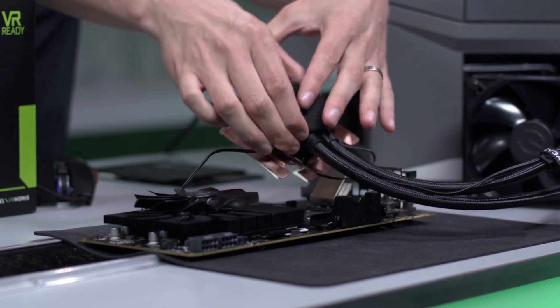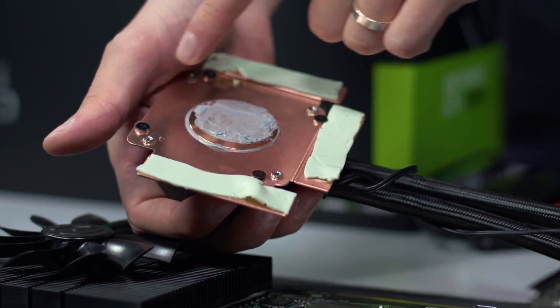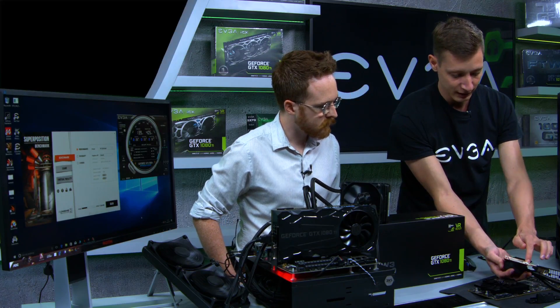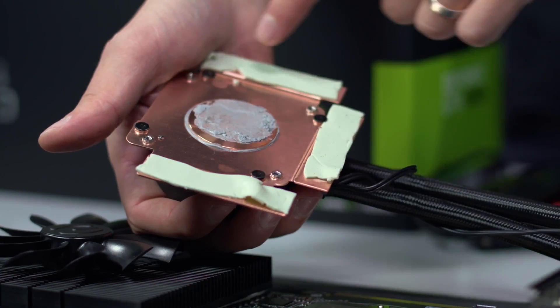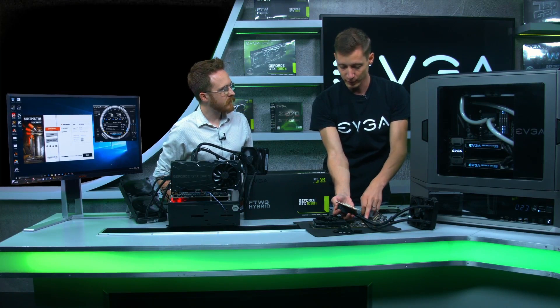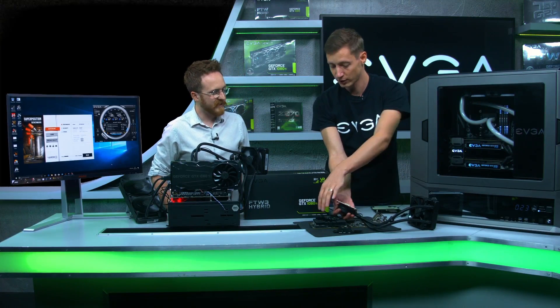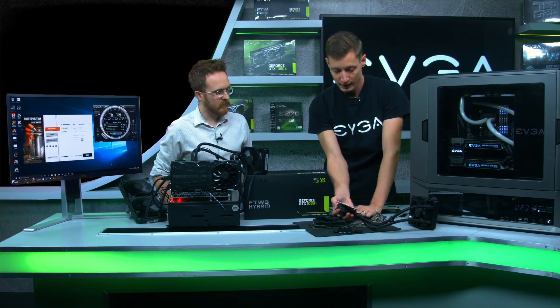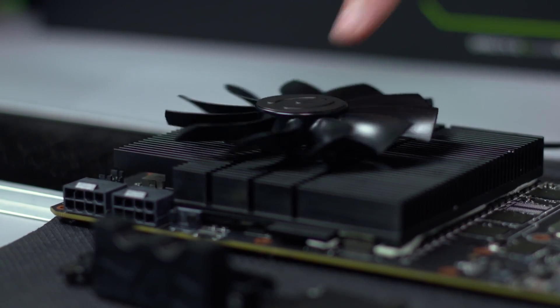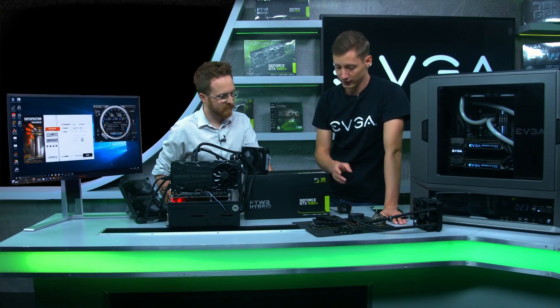What's really unique here is there's also a dedicated copper plate — not just the copper base for GPU cooling, but another dedicated copper plate connected to the copper base to cool the memory ICs. You don't usually see that, but it's very important on this generation — not just for the GPU but also the memory ICs and power. That's why we installed this extra copper plate with thermal pads cooling the memory. Then we have a massive heatsink for the power segment, with the air fan controlled by the ICX sensors on the back.